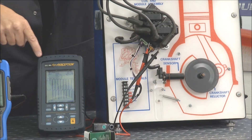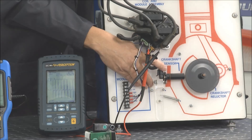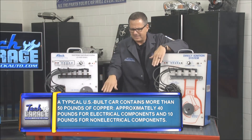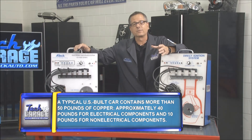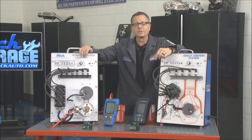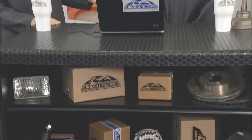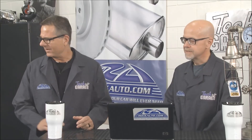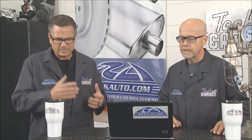Over here is an actual AC signal — alternating current voltage. You can see it pulsing up and down. If I speed it up, it goes tighter. This one is susceptible to air gap — if I reach down and open it or close it, it has to be adjusted accordingly. That's how your car functions with electricity. I got these sensors at rockauto.com — everything you see on the tables is available there. Tom Taylor from rockauto.com is joining us, so let's go over to the table.